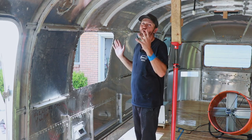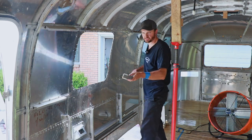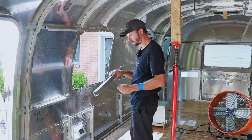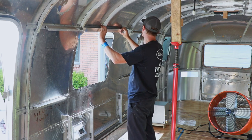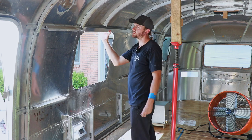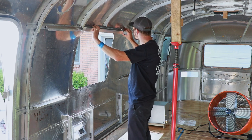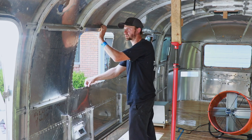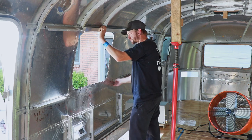All the supports are out and it didn't cave in on itself — always a good sign. The next step: I have the first piece cut for building the frame. This is the C-channel, basically one and a half by one and a half, eighth inch — point one two five. I'm going to place this first piece up here, put a C-clamp on it to get it momentarily held in place, then move it around to position it exactly — level it up to the trailer, left to right — then put a few holes in it and get some clecos to hold it in place.